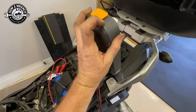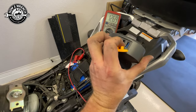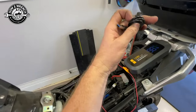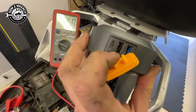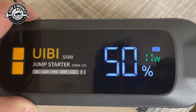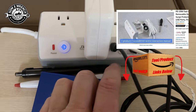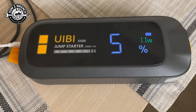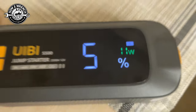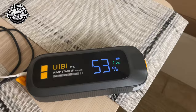It has features like lights, and you can turn those off. It has ports — one of these is both in and out. The USB-C, per the manual, is in and out, and that's what the charge cable is: it has a USB outlet end so you can plug it into your wall. One thing to note is it has a maximum specification of 15 watts. Here you can see it's charging at 11 watts from this plug. A 20-watt charger would be too much, so make sure you know what you're working with and use the right charger.